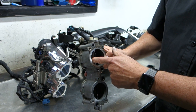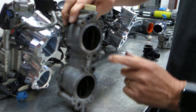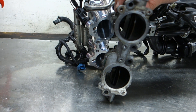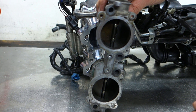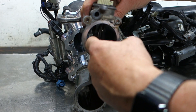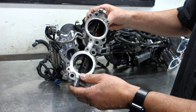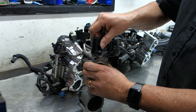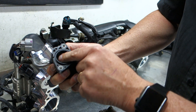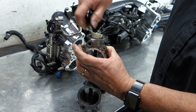That is the TGVs - tumble generator valves. You can see it's effectively an old-school choke. Depending on when the car is in cold start mode - it only uses this component on cold start to get the car up and running. Once the car has gone through warm-up mode, the engine control unit will open that up and you're left with the butterfly in the middle. You can grind all this out, but these days it's a lot cheaper to buy one of the riser replacements. If you're looking to save money, you can pull the shaft out, pull the choke out itself, and grind out the aluminium. Inside here is a little tiny gear drive driven by a servo motor, and that's what the ECU uses to open and close the butterflies. When you put them back together, make sure you put them in the right position - the motor doesn't know its location and just assumes it's in the default setting.